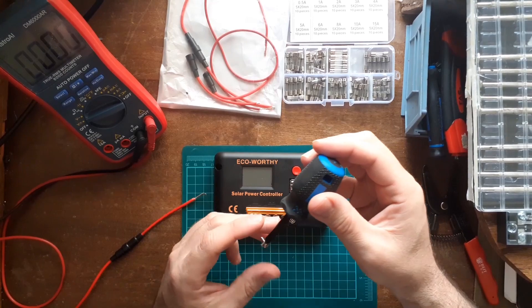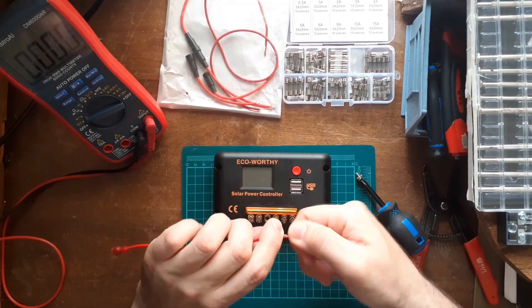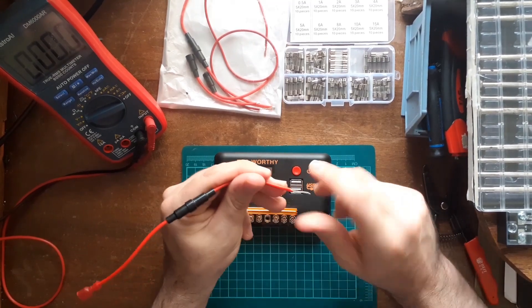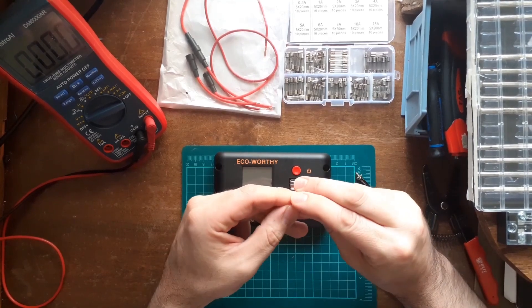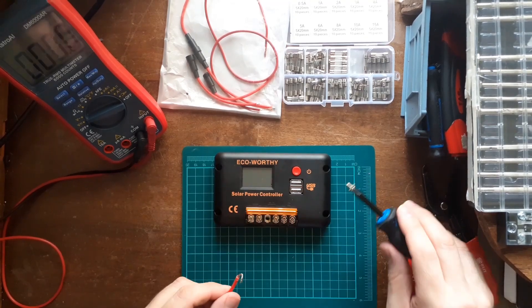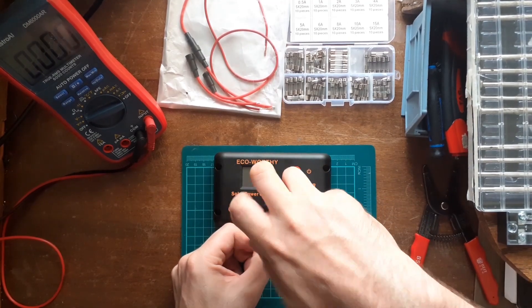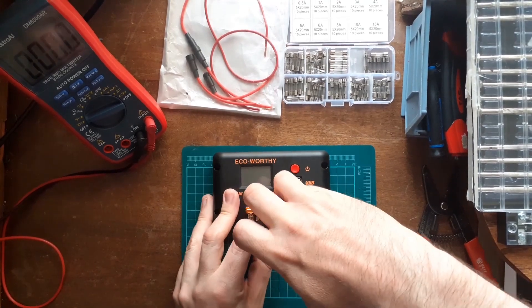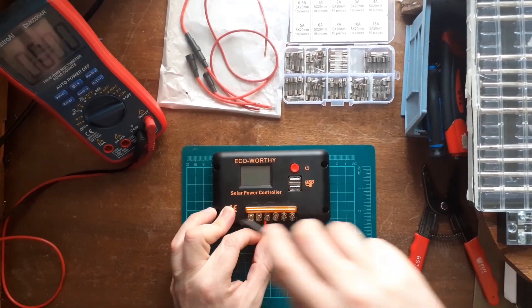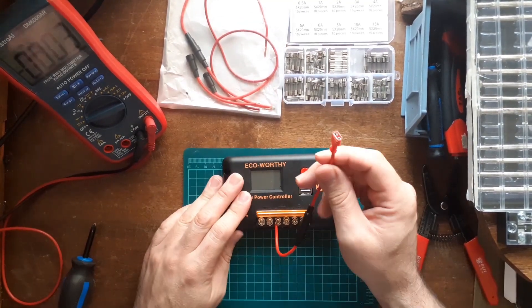It might help if you use a magnetic screwdriver when doing this — that way you're not dropping the screw every time. Take your fuse end with the terminal on the other end for the battery, bend it a bit without breaking it, then take the screwdriver and hold it in place. If it takes a few tries, keep at it until you get it in there correctly — you don't want it to be able to pull off or fall, because that can become a hazard. So that's connected to the positive right there, and it will go to the battery when we're done.